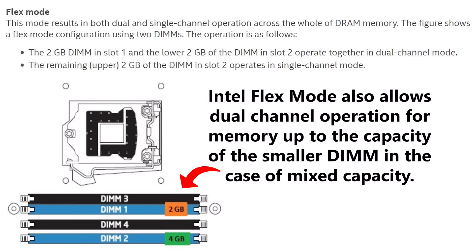I want to stress that when you start mixing so many different variables, you could potentially run into memory compatibility issues. There are reports of people running mixed memory modules and getting BSODs every now and then related to memory — it's kind of a hit or miss thing. I recommend running identical pairs of modules, or sets of four if that's your vibe. But if you must mix modules, try to get everything as close as possible so as to limit the number of issues.